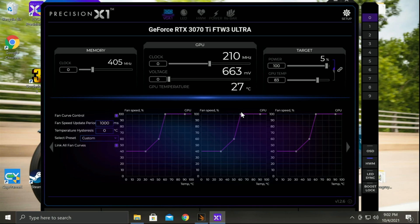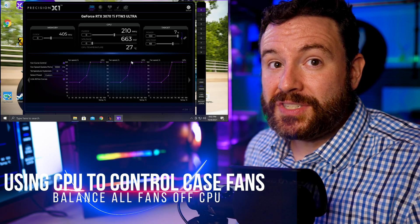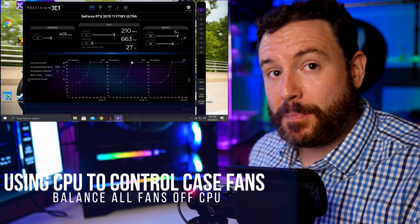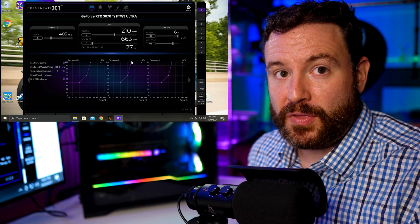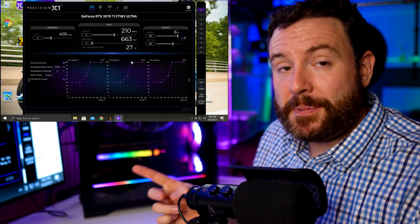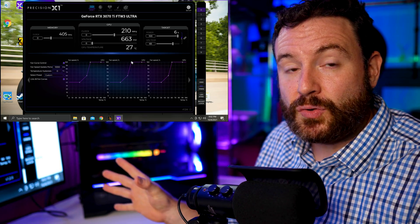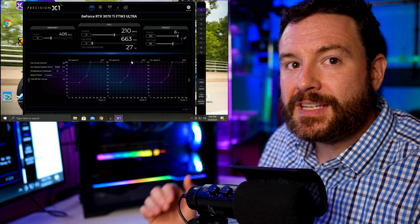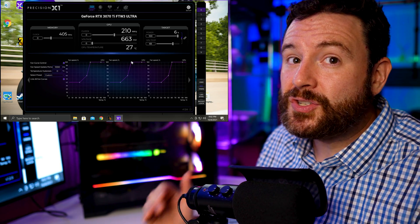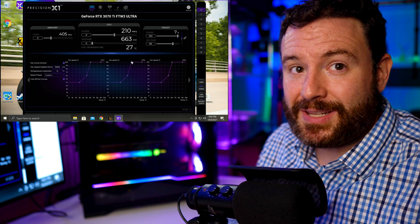Now this is all the GPU, but on these systems you have to worry about something pretty critical. The intake and exhaust — your system fans — connect to the motherboard in order to move air, which means they use a temperature probe on the motherboard. If you're gaming, your GPU is going to be moving a lot of heat. If your system fans aren't designed to ramp accordingly, you're probably going to run into a problem. If we only spec for the CPU, we're going to starve the GPU of the air it needs, which means we're going to run hotter than we actually need to.